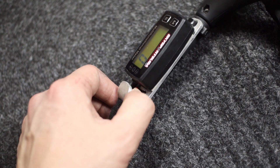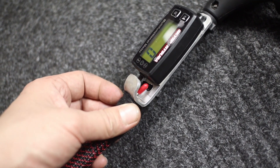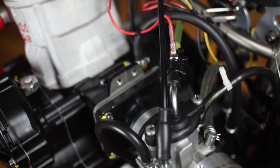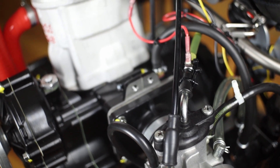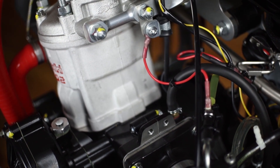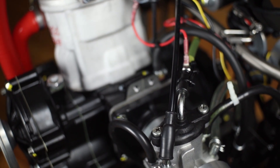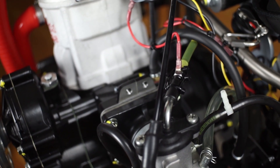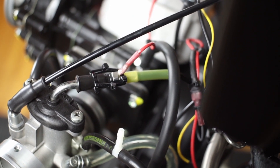A little piece of aluminum protects the LED switch from being accidentally actuated. Here's a close look at the ground wire to the kill switch for the engine, to ensure there's an excellent ground. With the Polini, there's not an excellent ground built in, so you have to add your own. You don't want to rely on metal-to-metal contact through these slide mechanisms — you can see that through the carburetor.